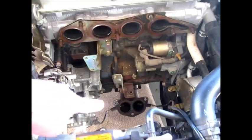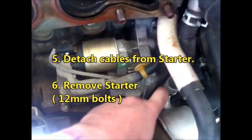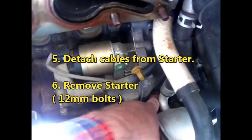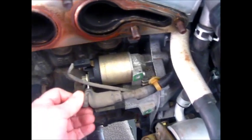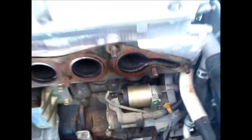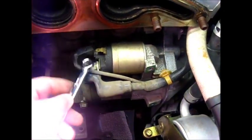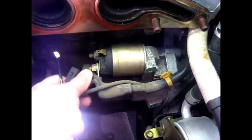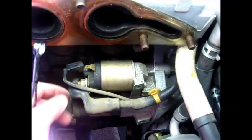As you can see, the exhaust manifold's off — I've got it placed right there. You have to get a new gasket kit for that. Right here's the starter, and there's two bolts: a bolt right here and another bolt right down here that you're going to take off. This connects the power. This here took a 12mm wrench to unscrew. You want to pull these wires off before you start to unscrew that, because you don't want to break these wires — they kind of get in the way when you're trying to unscrew it.